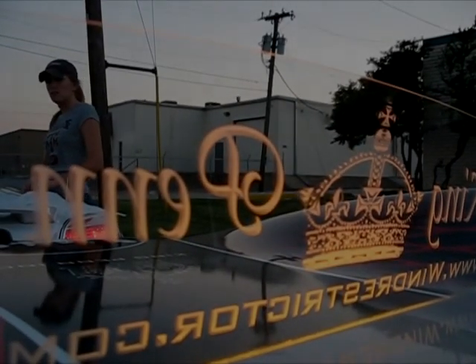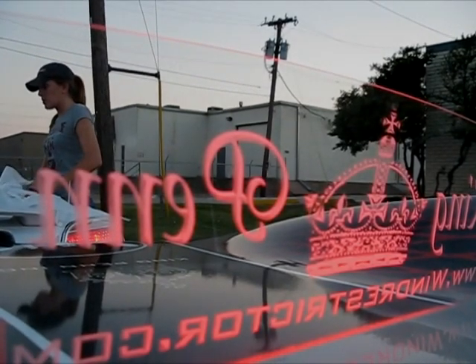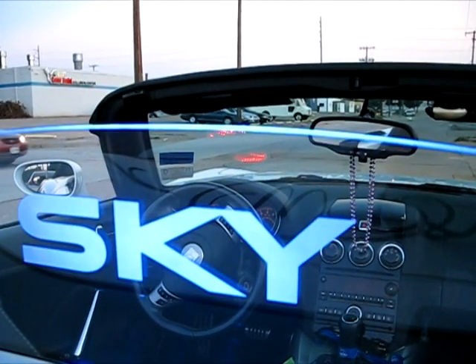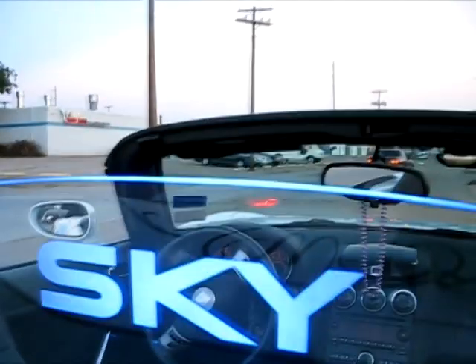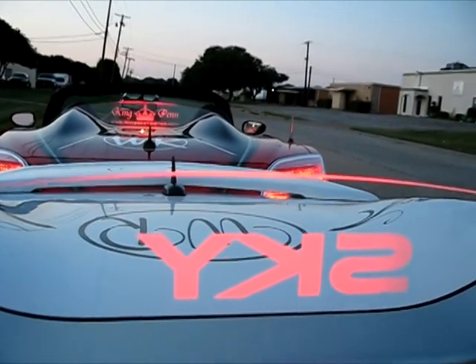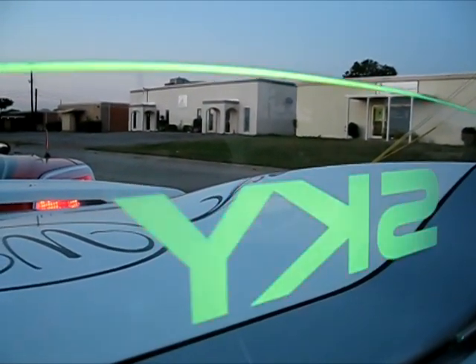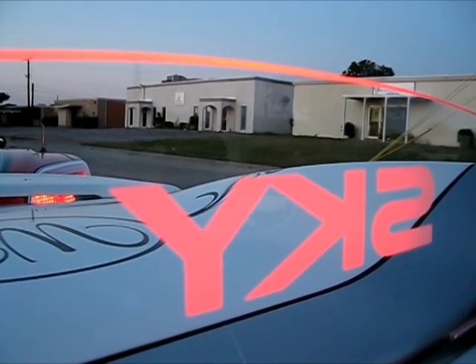Finally, we have the extreme lighting kit with remote control. This product can be hard-wired to your headlights or running lights, or you can hook it up with a 12-volt adapter plug to eliminate the hard wiring. You can use either the dimmer module or the brake lamp module along with this accessory. However, if you do use the brake lamp module along with the ELK, you would need to turn the intensity up at least halfway to utilize the full range of colors, because the ELK requires a full 12 volts to operate all colors. The extreme lighting kit is great because you can use the remote control to set the product to any color you like while driving, and it also has a fading option that allows the product to fade through multiple colors while driving or parked.